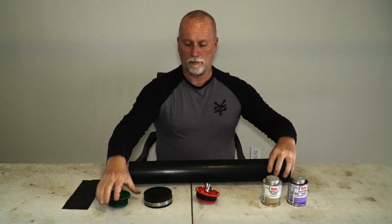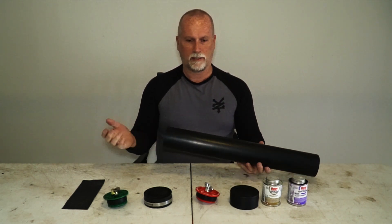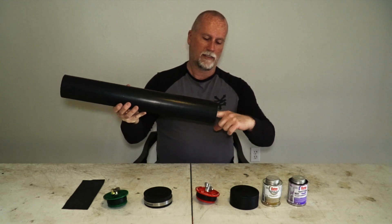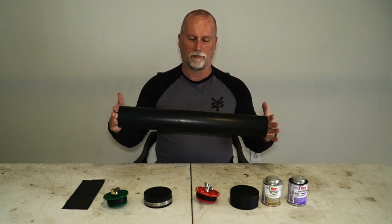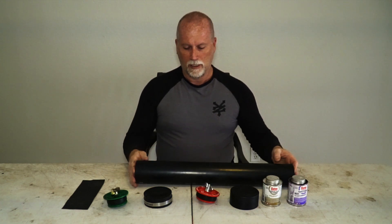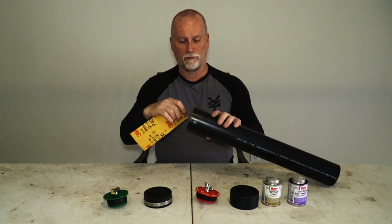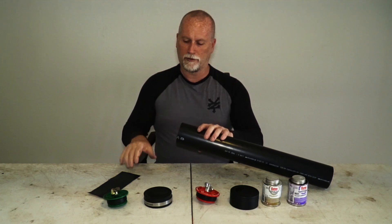Keep in mind: if you're taking tools out and they're wet — say you're changing a tire in the rain — and you put them back in, moisture is going to puddle at the bottom of this closed section. So keep stuff in here dry. Also, before you finish and head out on your trip, get a little sandpaper and run it around the edges, inside and outside, because these have a little burr on them and can be a bit sharp.